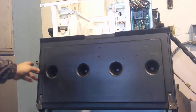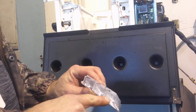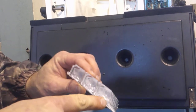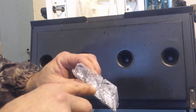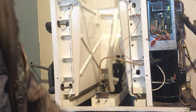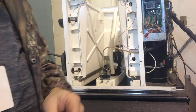One thing you want to do after it makes a sheet of ice is take a chunk of that ice out of the bin and look at our bridge thickness. This line across the bottom of the ice cube is our bridge. This particular manufacturer requires an eighth-of-an-inch bridge, which is about the thickness of a nickel, and that looks pretty good — pretty close to an eighth of an inch. So we don't necessarily have to do any adjustment to our ice thickness control. It's set to give us that eighth-of-an-inch bridge thickness, and this ice machine is in good operating order.